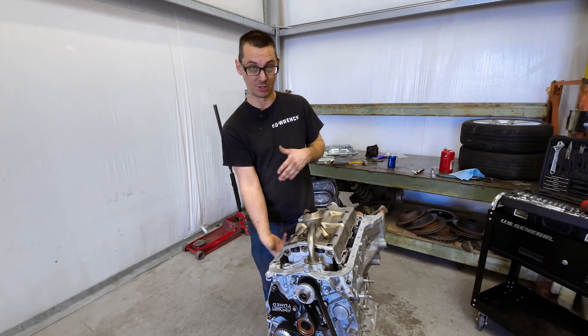Show them the crusty. This is the thermostat housing — it goes here, but we're not going to put it on yet because this looks horrendous, so I'm going to go clean it. This is a kit to put a K-Series intake manifold on an H-Series, because no one likes the ugly H-Series manifolds that are all super long and almost touch the firewall. It allows you to run a lot better intake manifold designs too.